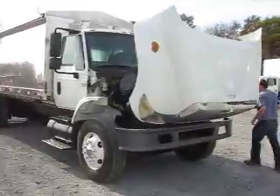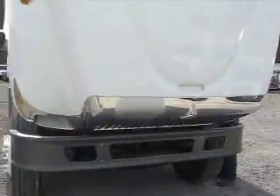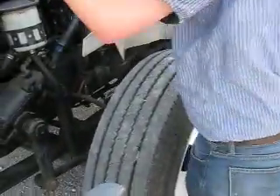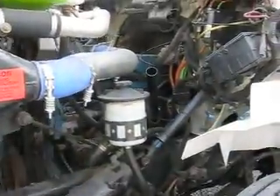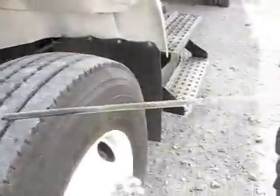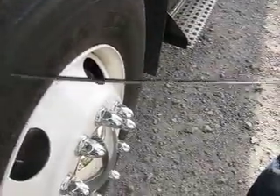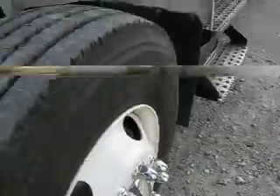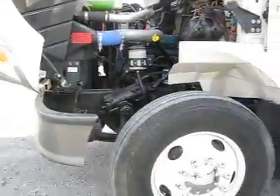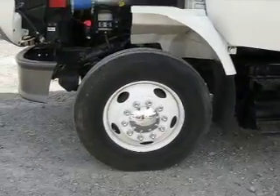As you can hear, the engine just fired up — purrs like a kitten. Dave's going to pull the dipstick tube and let you take a look at the actual engine oil. As he does that, take a look at the filler — you can see there's absolutely no blow-by coming out. Look at that. I can see right through the oil onto the dipstick; it's nice and clean. Dave is going to go ahead and shut off the engine so we can hear better in the video.